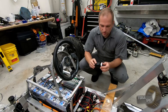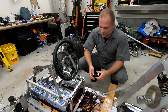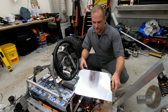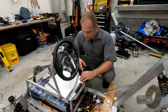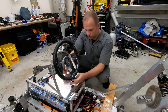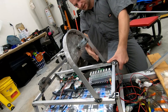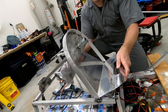Next thing I want to tackle is installing our reverse neutral drive switch. For that, we need a mounting place. I didn't have the foresight to buy any sheet metal ahead of time, but I do have this mixing pan from Harbor Freight — it's just for mixing epoxies and spackle. It's just the right width, and it's got this nice curvature that can work as a backboard. So all we're going to do is bend it right here on the back side, use it as a backboard, and install our switch right here. It lines up perfectly — flat on the bottom with an angle on the back. We're going to trim it up because right now it's too tall.